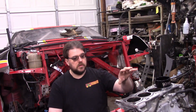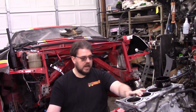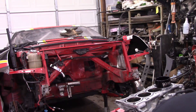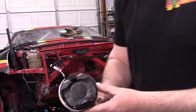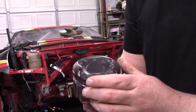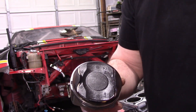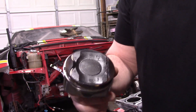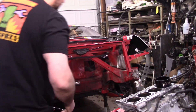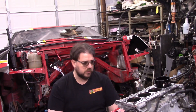What led me to finally pulling this completely out of the engine is, after the dyno session, I went ahead and did the compression test again, and I threw a borescope down there. If you look at the piston — this is number four here, but they all look like this — it's hard to quantify on camera that these really are not very deep at all. These are actually hitting the exact shape of the recess in the piston, so they did touch. They obviously did touch, and that's bad. At this point we must have something wrong internally, because the valves have touched. I don't know why — it's not causing leak down issues, but surely there's a problem, so let's take it all apart.